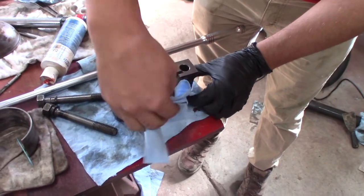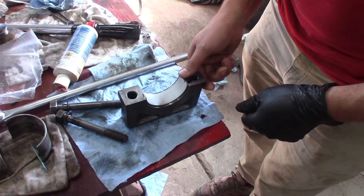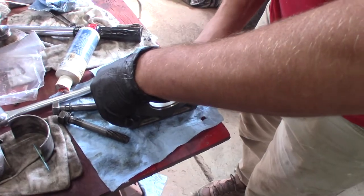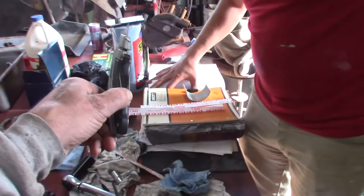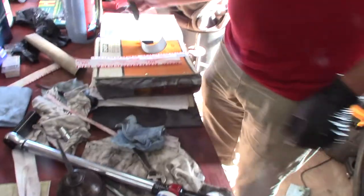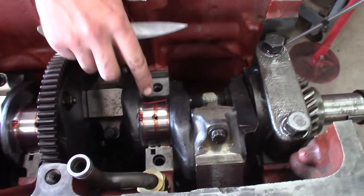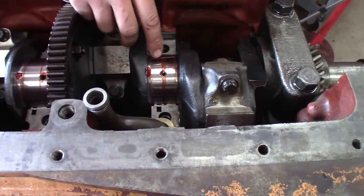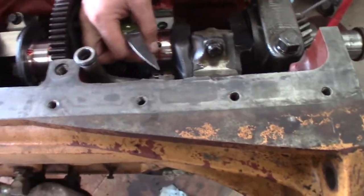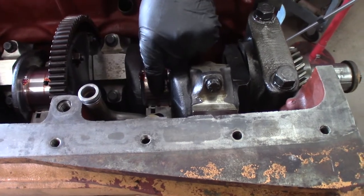How about cleanliness — nice and clean under the cap. A little bit of assembly lube will hold that in place. That's a good way to keep it on the edge if you're going to do more than one piece. If you've got thousands of dollars in measuring equipment, go ahead and use it — the plastigauge is like a couple bucks. It's not perfect for everything.